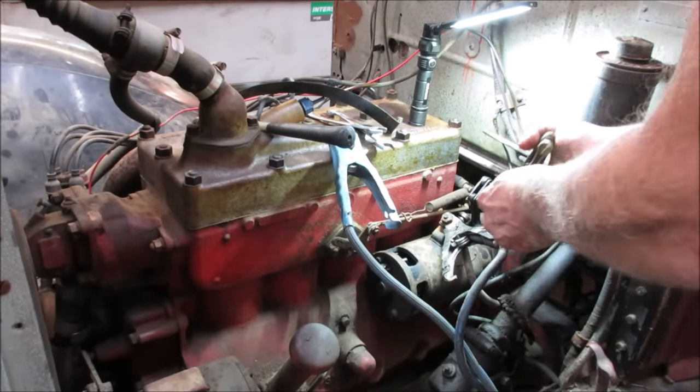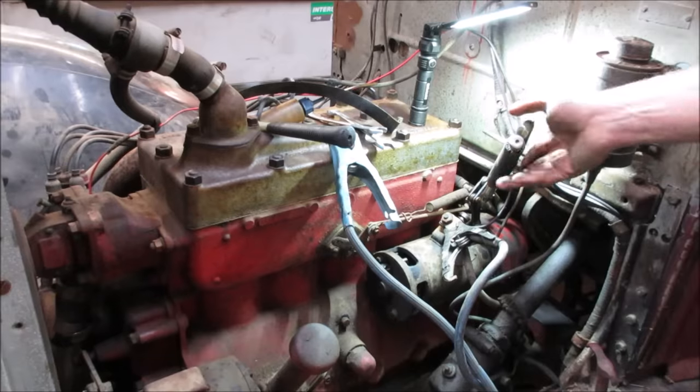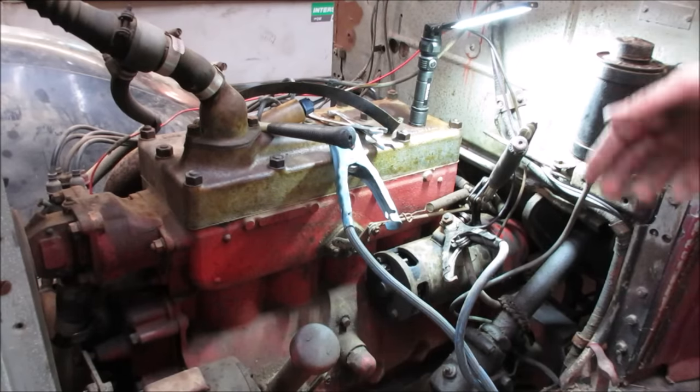Tempted to kick it over to 12 volts. The thing with 6 volt and 12 volt cars, 6 volt cars are very particular on having really heavy cables because you're drawing double the current for the same amount of work. So sometimes even like the jumper cables might not be doing us great because of just the resistance going across it. We'll keep bumping a little bit.